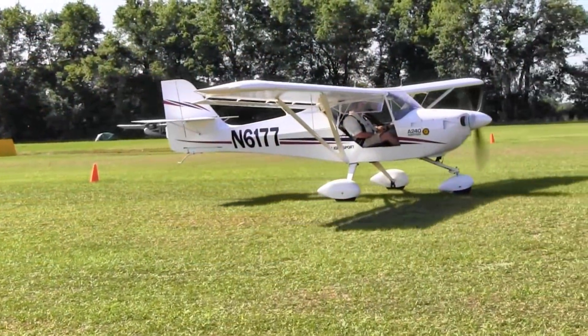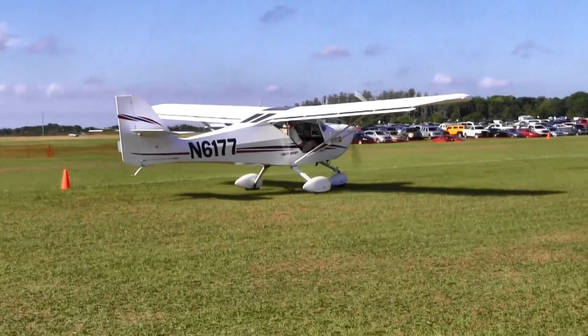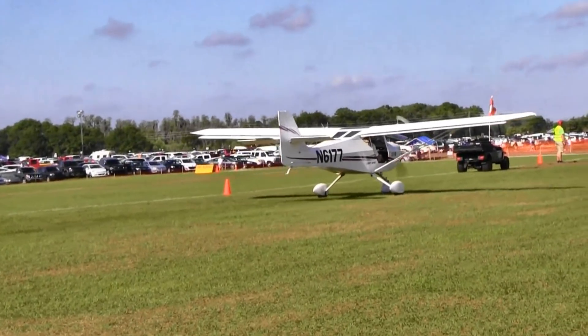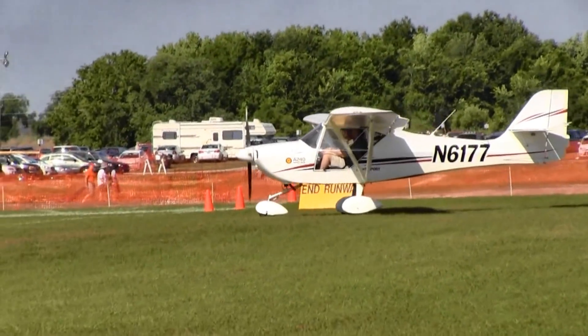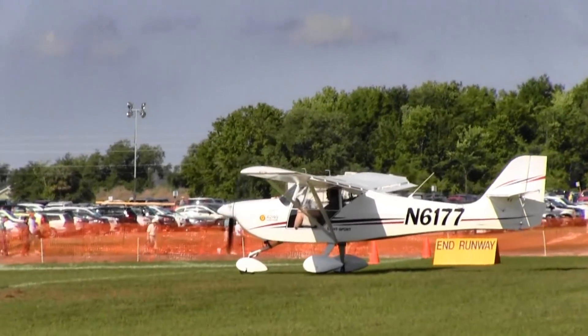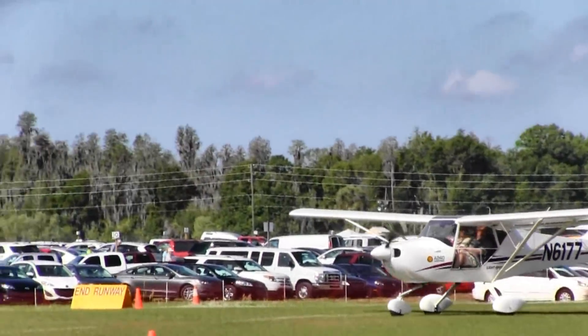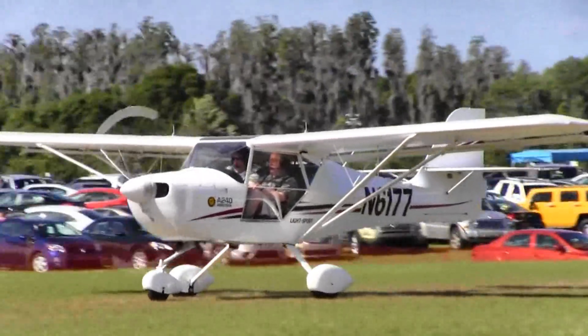The standard features: the plane uses the Rotax 912 ULS engine — 100 horsepower, around since 1999, the follow-up to the 80-horse engine from 1989 — the most popular aircraft engine in the world right now. Our plane is a high-wing with folding wings, available in tricycle gear or tail dragger, two-seat side-by-side with control sticks and rudder. The tricycle gear is nose-wheel steering — not castering, nose-wheel steering. Most buyers are old GA pilots or airline pilots with GA time, and after just a few hours they get used to the lighter control forces in an LSA plane.